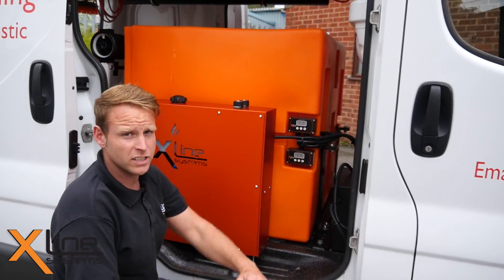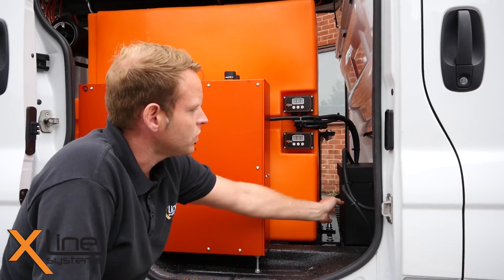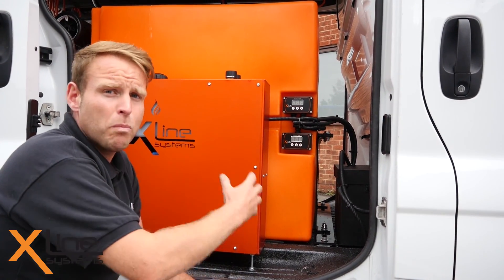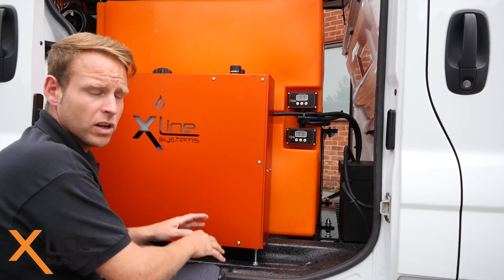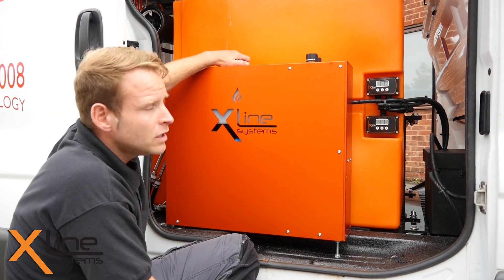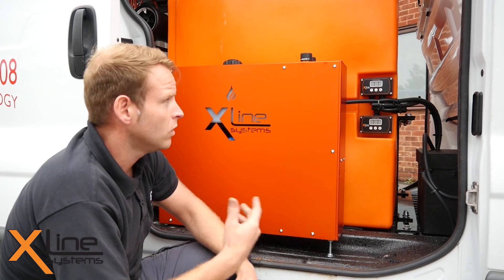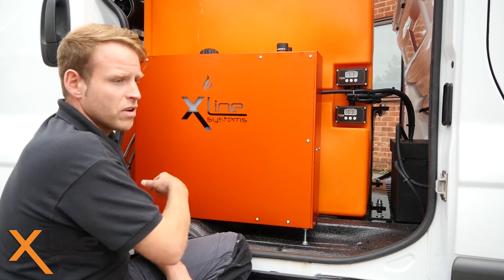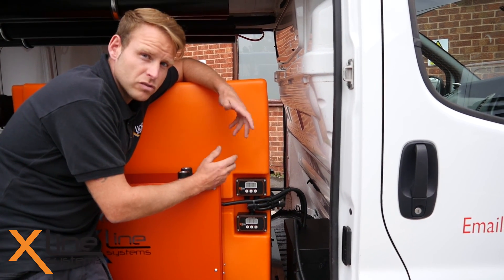On this side you'll see the controllers, with two more mounting positions as well. You'll also notice this black box here — that black box is not normally present; it's only there if you go for the diesel heater option. Because this system needs more power, it has an additional 110 amp battery, giving two 110 amp batteries total, housed in that box to accommodate the nine kilowatt heater. This is the nine kilowatt diesel-powered heater unit, with running costs of around 700ml of diesel per hour. The settings and operation are all managed from this control box.